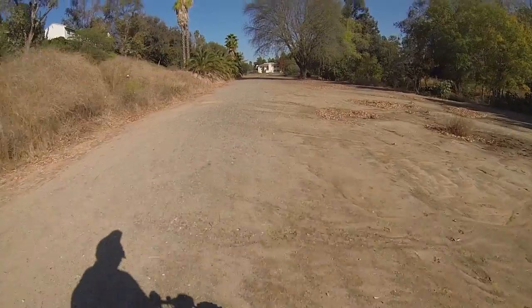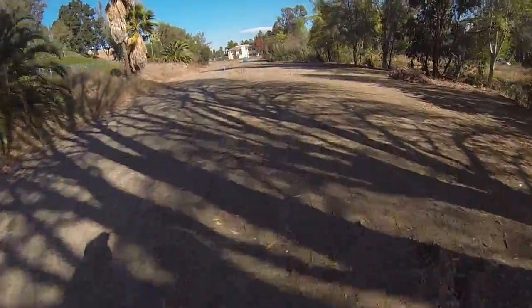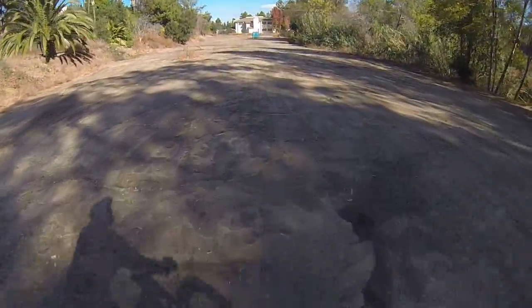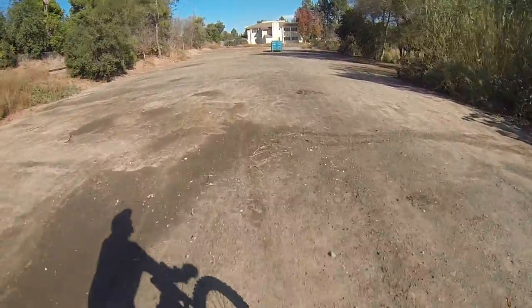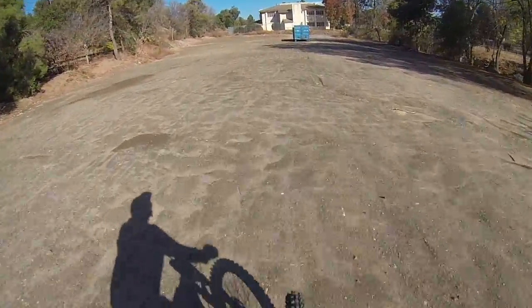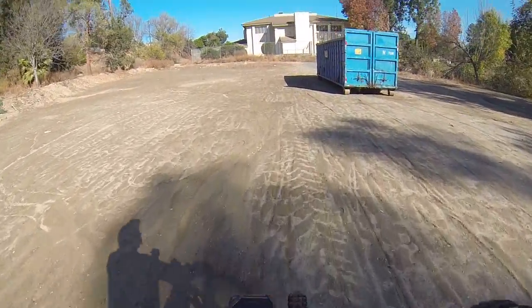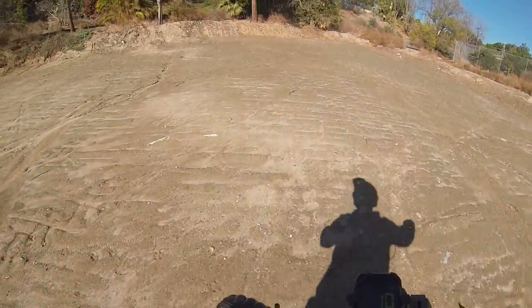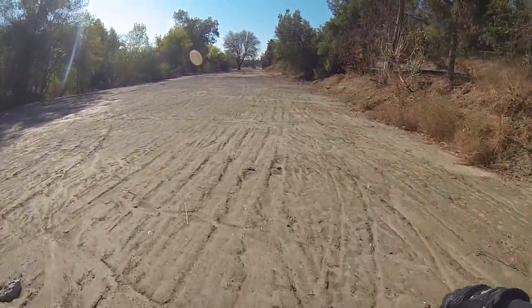And because I didn't have any comm cable, I think my controller thinks that I'm running a 16S all the time. So when I'd run in sport mode with the X160 battery, the bike would cut out sometimes, and I'd have to power cycle it just to get it back running again. So it did rain a couple days ago, so that's why the ground looks like this.